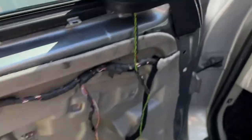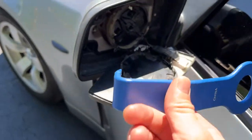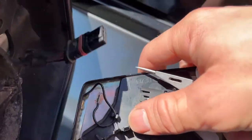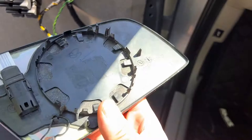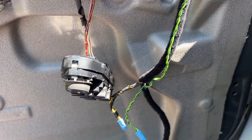Isn't that odd? So with the mirror plugged in, I started to take apart the mirror assembly, starting with the glass. You can just pop the glass off with one of these trim tools — stick it in there and lightly pry a little bit, just be careful not to break the glass. Then I disconnected the mirror because this has auto-darkening and heated mirrors. Use a little flat screwdriver to lift that tab up and it just pulls off. And look at that — it works again! So this glass is actually our problem. There's probably some kind of short which is causing a communication problem, because the auto-darkening part has something to do with the window switch communication.